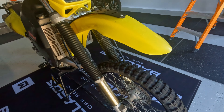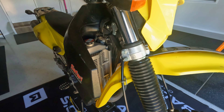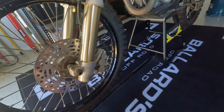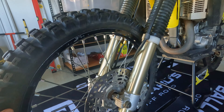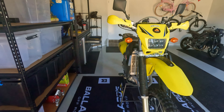For the forks at the front, they're even easier. Same again, take your tire off and get that out of the way. Then you've just got all your bolts up here to undo - these two here, these couple up here - and then your forks will just slide down. Obviously there's a few other things like your brake calipers to undo, but it's pretty self-explanatory. Once you start trying to get it off and move it down, if something's holding it there, just be careful, find out what it is, remove it, and then it should all come out nice and easy.